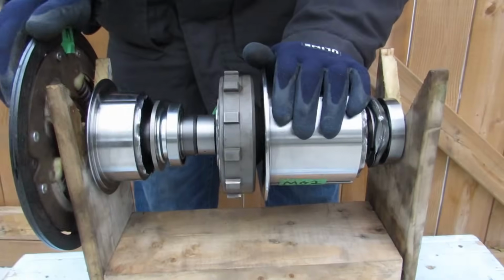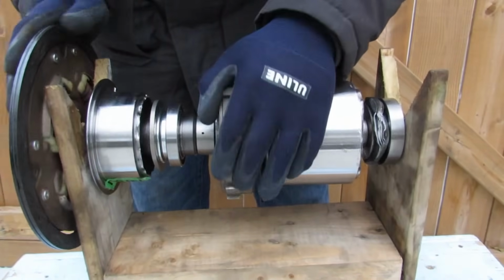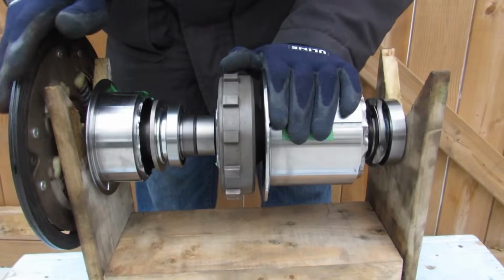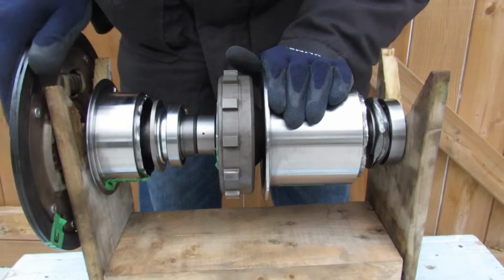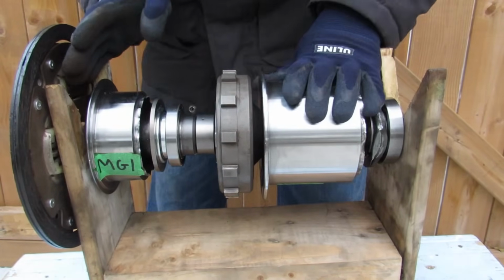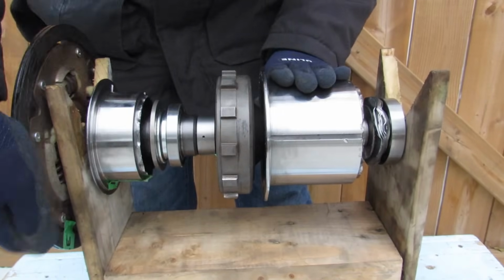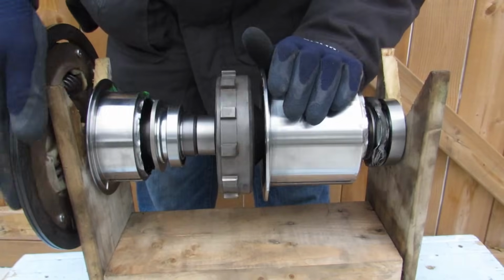Now in mode 3, during acceleration, you're going to have your internal combustion engine that's rotating and MG2 that is rotating. This is contributing directly to the wheel speed, whereas the internal combustion engine is both helping this guy out, but it's also rotating MG1. Now that MG1 can be used as a generator to generate power and charge the battery pack, but it's the variation between the internal combustion speed and the difference of the ring gear, or MG2, that allows the continuously variable aspect of this transmission to work. The more power and RPM you put to your internal combustion engine and MG2, the faster it will go.